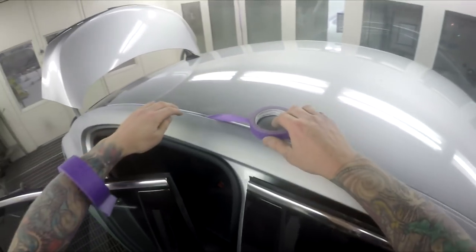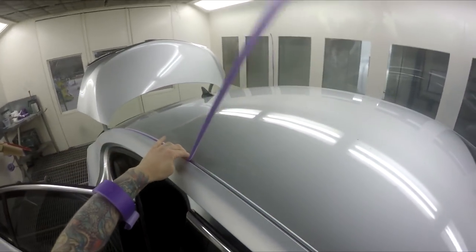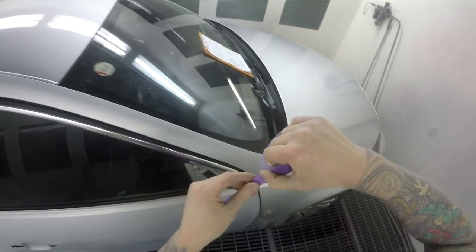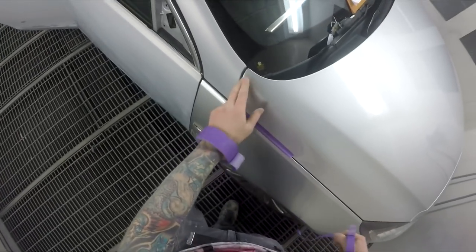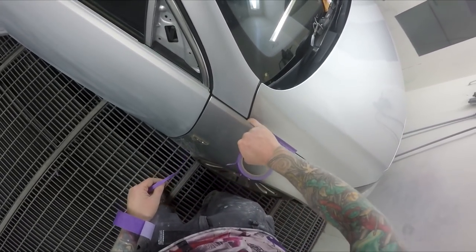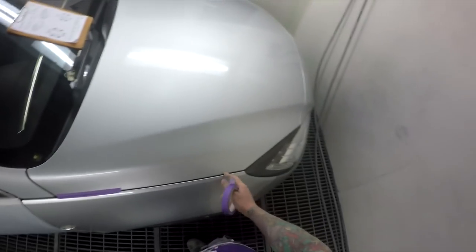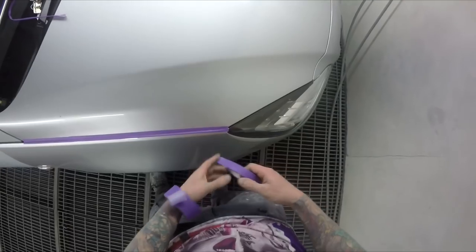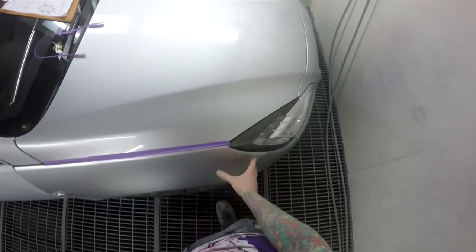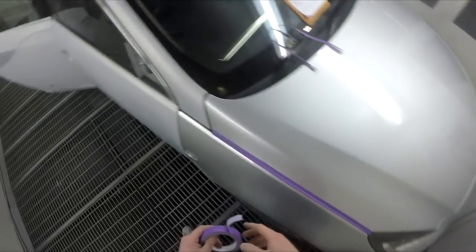So obviously here we've got a body line — I'm just doing a bit of a false edge right up here. That edge has flipped up, so we'll do away with that. This is actually a handy thing I do sometimes when doing panels like this — sometimes you can get a little bit of paint coming through and it can end up coming out these gaps, leaving you with a bit of misty overspray. So sometimes when masking up headlights, I'd put a piece of tape down there just to stop it from coming back out.